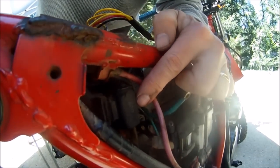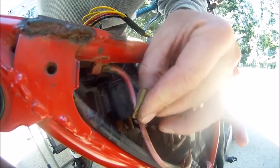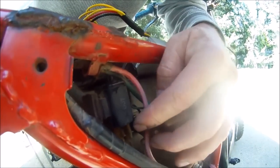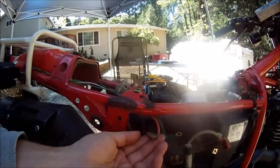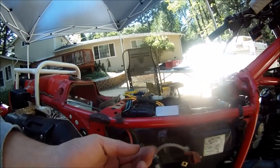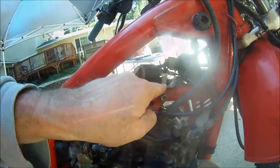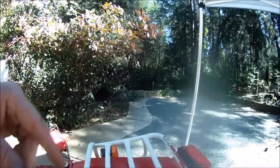Here is a flasher for the turn signals, and you'll see there's a spare ground wire here. Looking at the original schematic, that's correct — there was an extra ground wire right there, with only two wires going to the turn signal relay. The actual ground for the entire electrical system is right here, right in front of the ignition coil. And from there, the wires work their way back to the turn signals and the rear tail light.